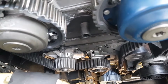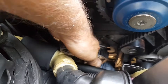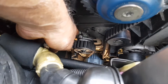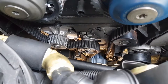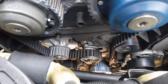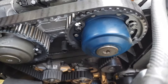Feed it all the way down and go around the water pump last. The last thing you do is feed it over the tensioner. Once you've got it over the tensioner, tension it up until that tensioner mark — this section here — is in line with that section there, right in the middle. In service that's going to wobble around both sides, but that is the position it needs to be in to be properly tensioned — automatic tensioner of course.